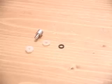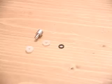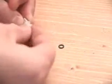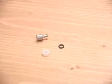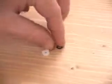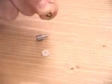There's really 3 ways of doing this. The first one is with motherboards that have large holes should actually use the nylon shoulder washer. So this right here plus this, like so. Then down below the motherboard you would screw the plastic nut like so. The other way is motherboards that are not grounded with small holes. They should use the black fiber washer, which is this one, and it would be installed like so right here, and then of course this goes down through the motherboard, and this plastic nut goes installed like this.